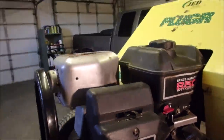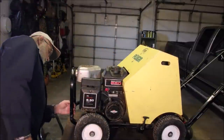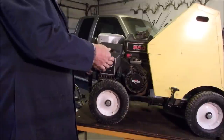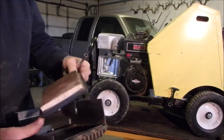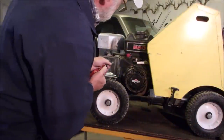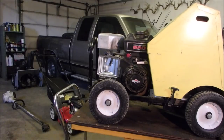Let's see if we can get it to bark. Gas is on — it was off when we got here. Let's just get that air filter off of there. As expected, a very, very dirty air filter and a pre-filter. We'll open it up, go to rabbit, and squirt some two-stroke fuel into the carburetor. I need more fuel in here — I'll get that in a minute. I got enough in. Let's just cheat and do a squirt too.